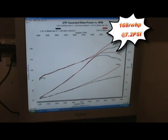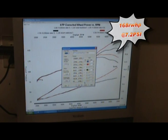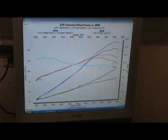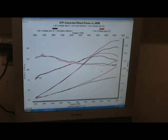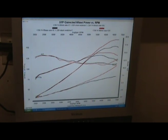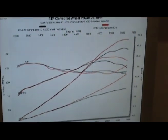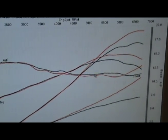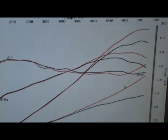Can you throw the air/fuel ratio up there? Now it will be fat since we aren't pushing as much air. The tip's going to be up a little bit because of the restrictor, but that shouldn't be dramatically different. Instead of running out of fuel, it's going down here at the 11.5 — nice and flat. So that's nice and safe.